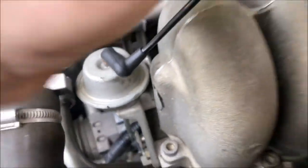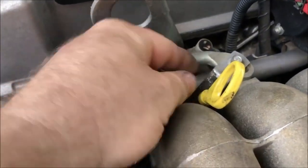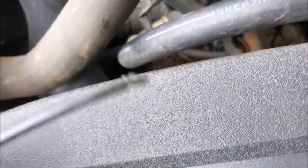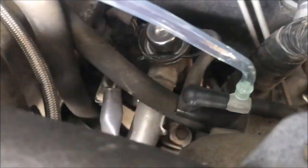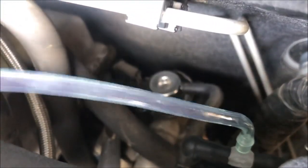We're 100% positive this butterfly vacuum line is completely disconnected. I've cut it and tucked it away — she's not going to get any vacuum. On the other side where it pumps in, I got my lighter, gave it a twist, and sealed it off, so there's no vacuum leak coming out of that. As far as my boost gauge goes, I've tapped into the same line that runs down to that little solenoid, put my T-piece in, and I've got my hose that will go to my boost gauge in the car.